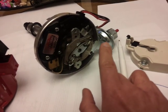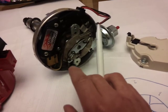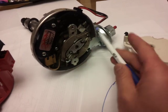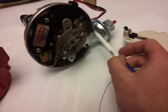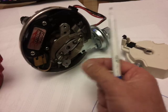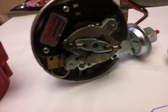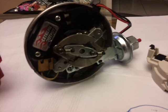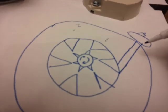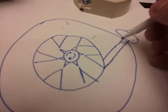When you first start up the car, the motor likes retarded timing — this is called initial timing. Once you start it and the engine creates vacuum, this vacuum canister here — which is pretty much like a diaphragm — senses the vacuum. Vacuum pulls in here and pulls a little lever, which advances the timing. Let me show you how that's done.